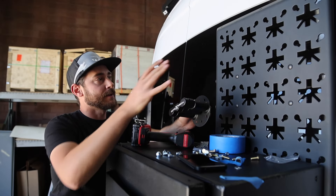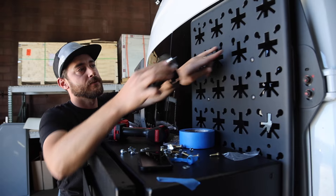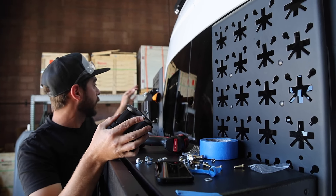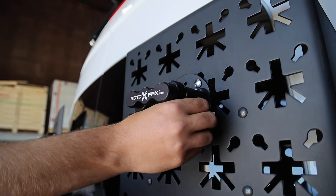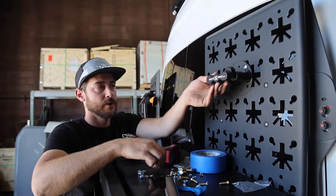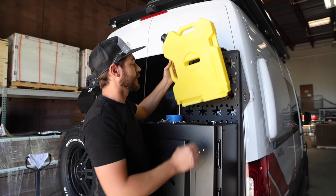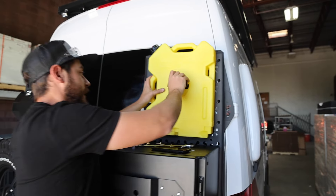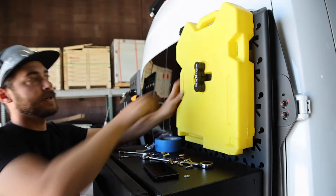There are a number of different ways to put items on here. In this case we're going to go from the front side since we don't have clearance in the rotopax parts. We're going to slide this in from the front with a carriage bolt — going for these two and these two locations. You'll notice this one is slightly longer. There's another one down lower and one on the other side high and low as well. I'll slide that on there, put a washer from the back side, put a nut to the back side, get that tightened up, and repeat for all four bolts. So we're putting on our rotopax — this one is yellow for diesel. There's a white one as well, and a red one for gasoline, but this is a sprinter so we're going with diesel. It just slides on there, spin it down, get it lined up, tighten them down, and that's not going anywhere.